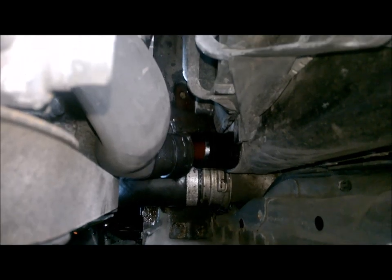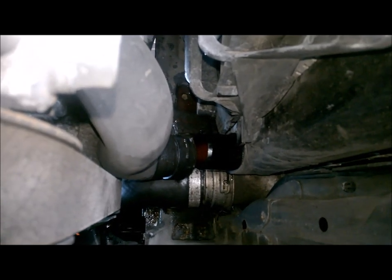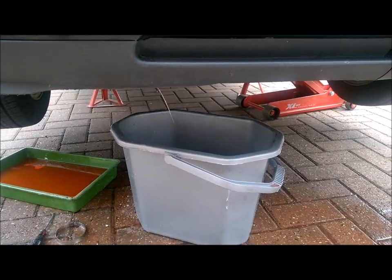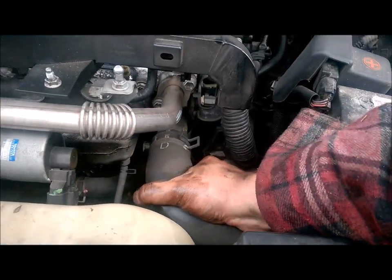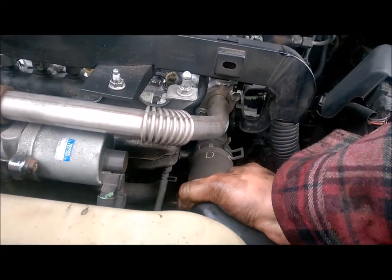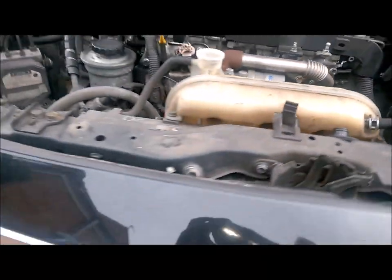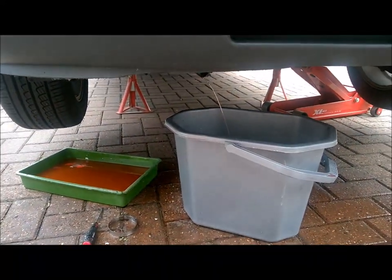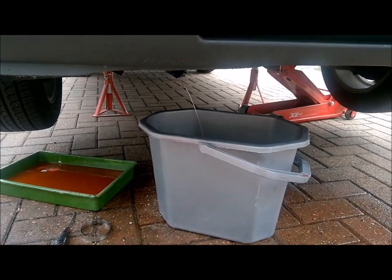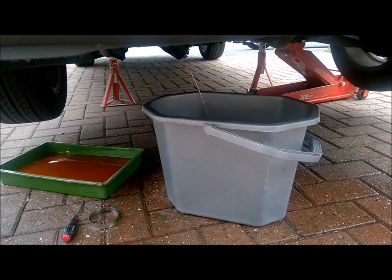As you can see from the top, you can see the bottom radiator hose and the pipe which I've just taken off. I'm also going to loosen the top bit from the expansion tank just to help it drain. Just like an oil change, you never actually get rid of all the old coolant — there will always be a little bit left in. So I'm going to leave it there for about 10 to 15 minutes.